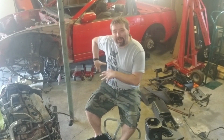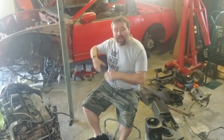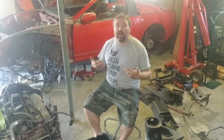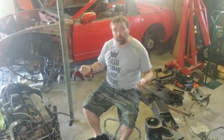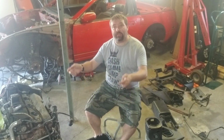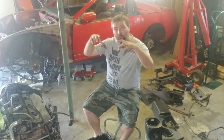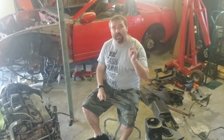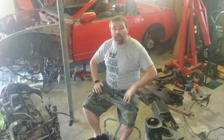And then the panel behind that, I'm not sure exactly what it's called, center panel, middle, up and out. That has 3 on top, 2 on the side. I didn't remove them and I didn't show you where they're at because they were already gone. There will be 2 screws there. Also for the kick panel aside, the trick there is you gotta get the glove box to open up. That was a pain for me. And then the shifter, 4 bolts hold it, 2 connectors, and then the safety cable, which you gotta pull the pin, the catch on it, and that's it.